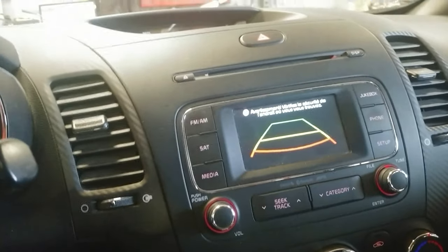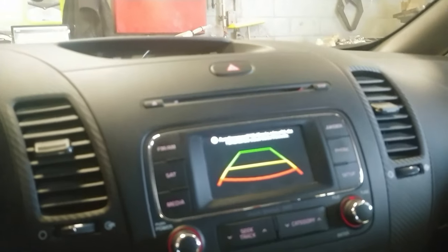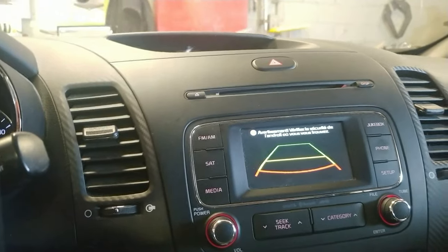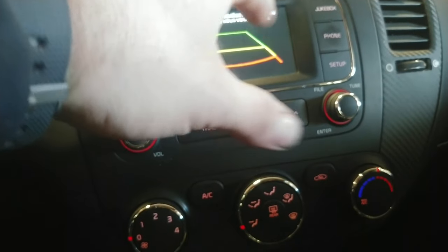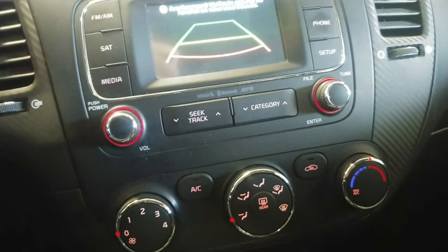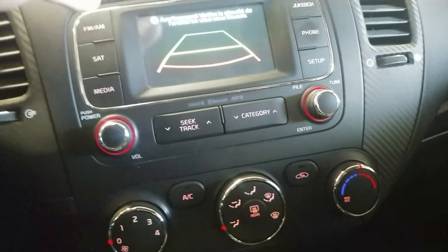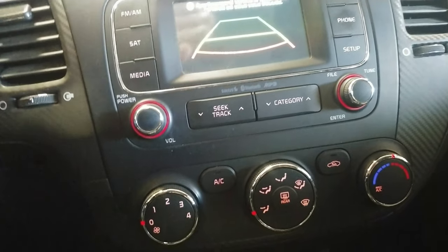The reason this happens is because there is actually an internal fault inside the rear view camera. Basically you have your power that's there, your ground is there. It's seeing that you are in reverse because you do have your lines, but the image is not coming up on the screen. We're gonna go verify some voltages and a ground, and the video goes straight from the camera up to the radio so there's not very much I could do with that testing.